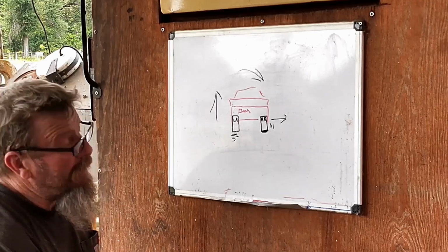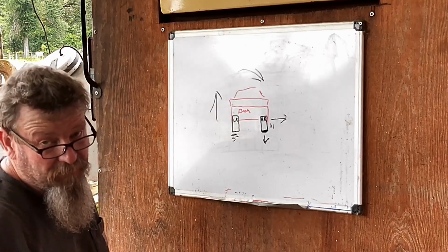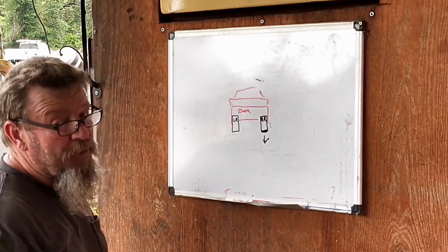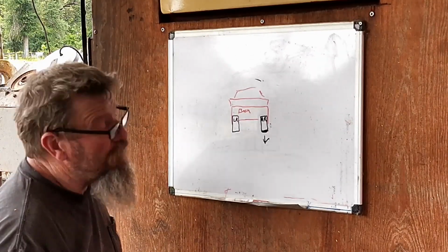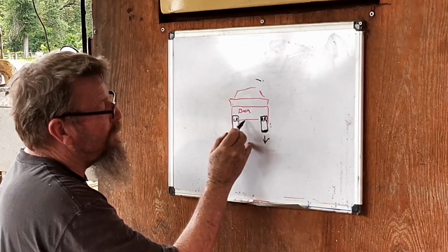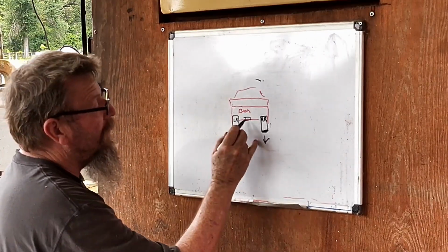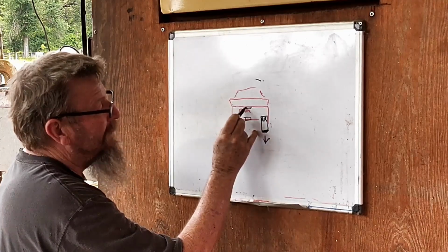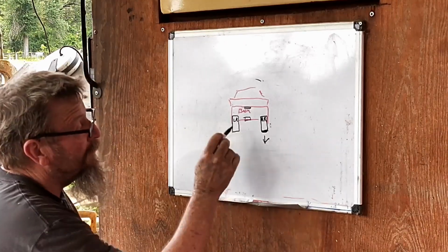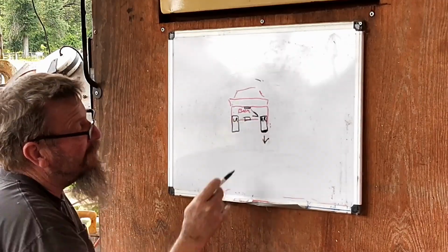In my mind, the only way to fix that is to push down on this tire more. And that's what I've done for years. But you don't have to do it on the scales. The thing is, some guys like to run low weight, and I don't like that. You can run your weight up. A lot of divisions have rules about it being under the decking, but that way when you're in the corner and it's up there, it's pushing down on that tire.